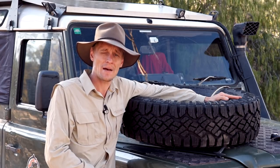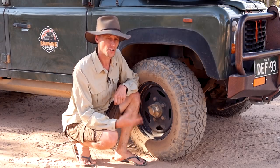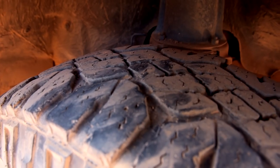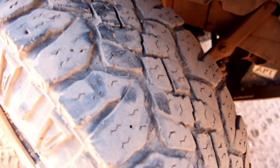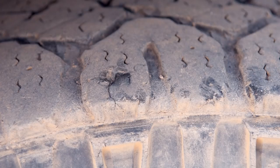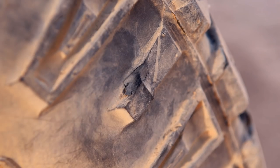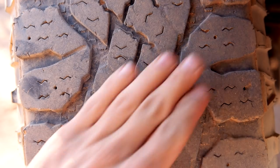Let's take a closer look at the tread wear pattern and the damage I've sustained in that time. I didn't rotate the tires every 10,000 Ks — I've only done it about three times in the last four years — but still, front to back there's fairly even wear. Damage to the tread itself is fairly minimal; from side to side, only on the angled blocks the standard chip on the edges. As for the sidewall, some of it is starting to chip off from big rocks, but otherwise it's protected the sidewall, so very happy with the way it's held up.